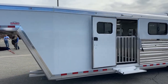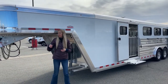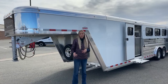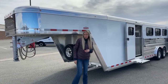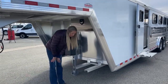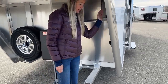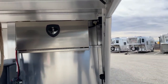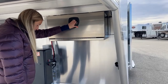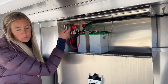Something we do on all of our Cimarrons is a 53-inch drop wall. What you're seeing here is that you get more bed rail clearance on those newer trucks — you only lose about three inches up here in your low-pro nose, but you gain the ability to drive level down the road without any interference with those bed rails. Up here on our drop wall we have our generator brackets. This trailer is set up with a power pack and shore power in this corner to plug your generator into. If you add AC units or run your fans, you'll have your power right here. With the electric jack on this trailer, you get your aluminum battery box with battery inside and a battery disconnect switch.